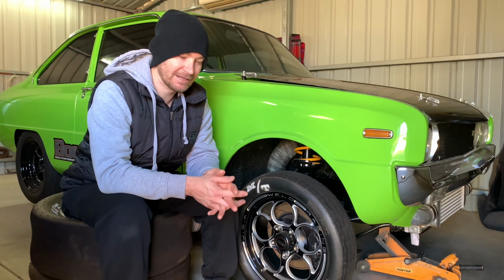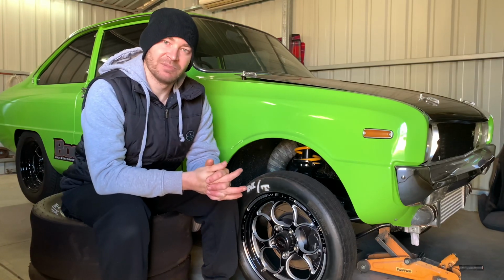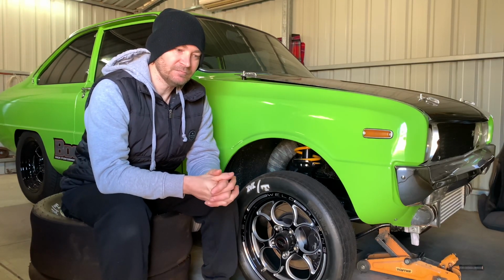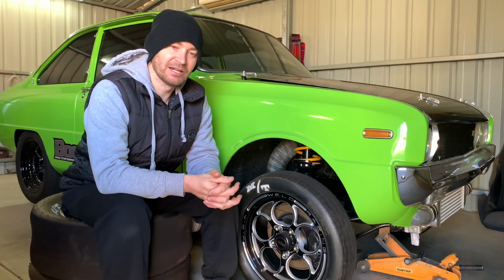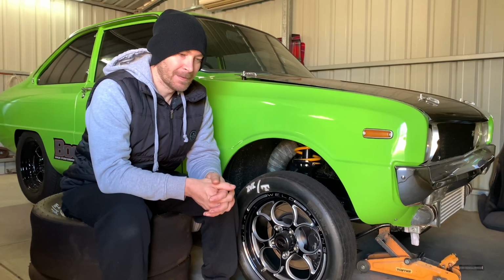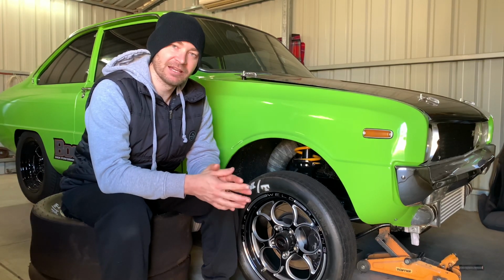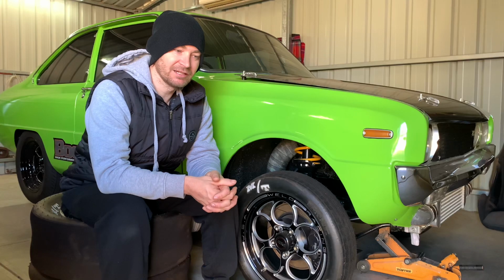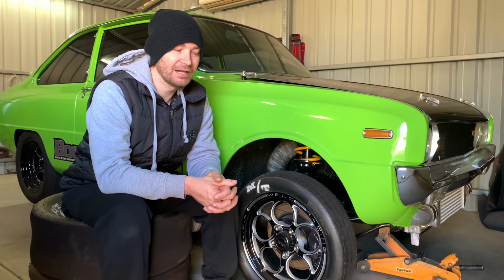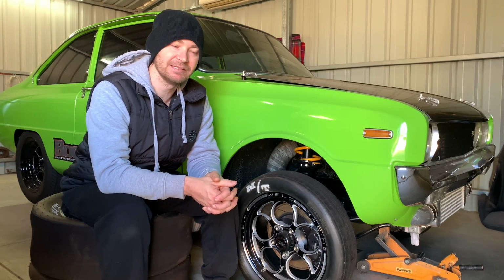So I bought an imported RX7 Series 5 13B turbo for it and upgraded the gearbox to an RX7 Series 5 5-speed manual gearbox, and was still running the van diff. I had to send the car to Adelaide to get a custom made exhaust manifold, intercooler, radiator and oil cooler done on it, which was all done by ASE in Adelaide.